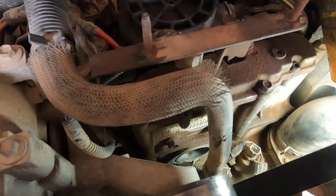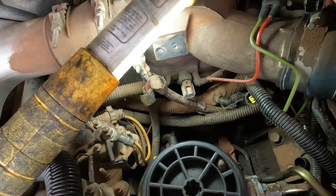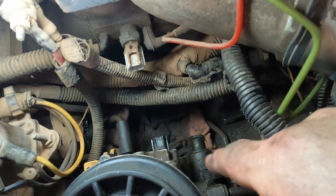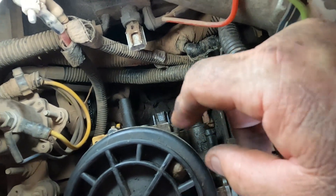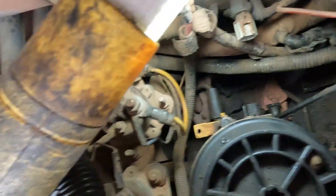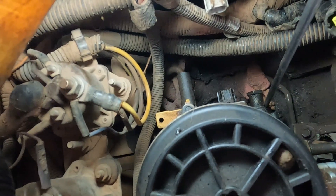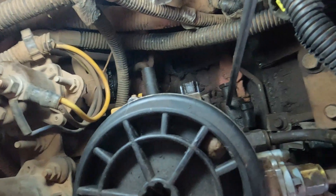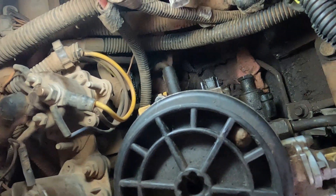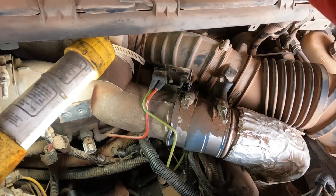Next, we've got to make more room for what's going on back here. I removed this piece that was up here. I've disconnected all these extra little wires here and there. That pressure switch back there, I've disconnected that. The only thing I've got to do now is take out two bolts - there are 10 millimeter head bolts. One will be between these two places down in there and the other one is back here. This big one has an 18 millimeter size head. Once I get those two bolts out, this whole piece will fall down and we'll swing it right up through here.